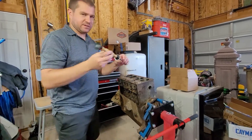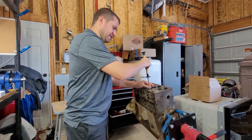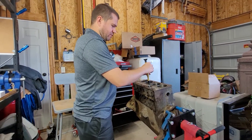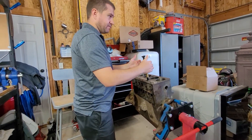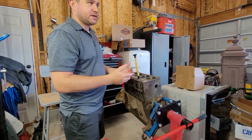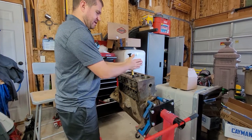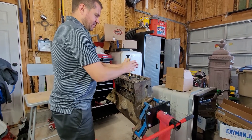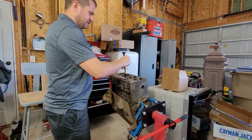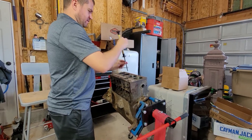This is number three intake, and I've put a very thin coat around the perimeter of that valve. Stick it in, spin it back and forth, then turn it 180 degrees to make sure the grit gets recirculated. I see some guys do this with drills — I don't really agree with that. This is such a fine procedure that a drill isn't necessary. Do a couple spins, pick it up, turn it about 180, and keep doing that. The suction cup always notoriously comes off, so always be ready for that.